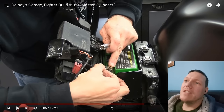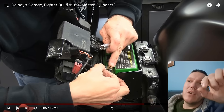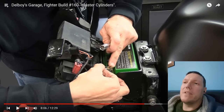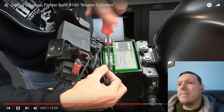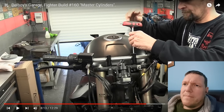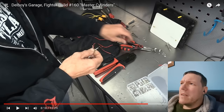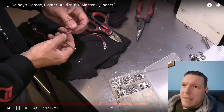The other thing is, it's not tight and your terminal's too tight. A lot of these blocks, or some of these blocks on some batteries, those actual terminal blocks that you clamp on, the little blocks are zinc-covered steel, but the little square nuts, the actual blocks themselves, are actually lead a lot of the time. Half the time. The turret is actually lead, so you've got to be careful. You don't have to literally cinch the crap out of them. Follow the torque specs. I think for that size thread it's like 12 or 16 newton meters. But check, don't take my word for it.